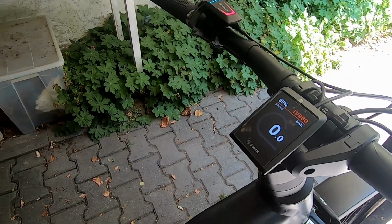So guys, I'm done with the road test. So the readings are a little bit weird, but anyway, the real speed is combination between the big and the small numbers, as I explained before. Actually, you can adjust the top speed by pressing the plus minus after engaging the tuning. It is also a little bit weird with the buttons, because you are activating the lights, you are activating the walk function. So once you are adjusting the needed top speed between 25-45, just leave it like this.